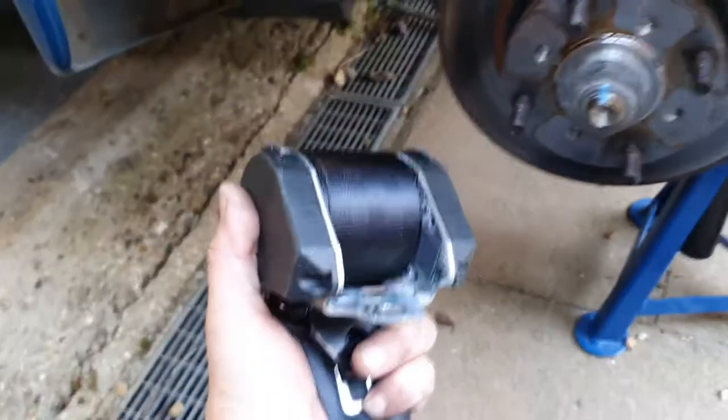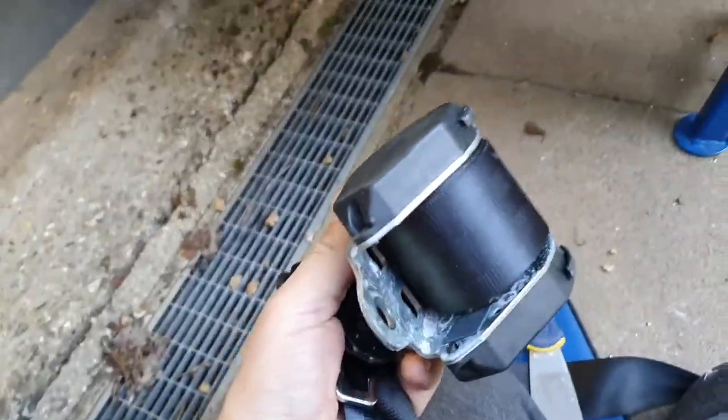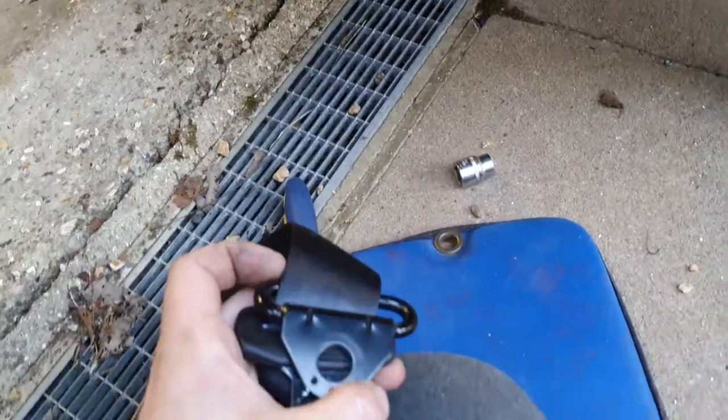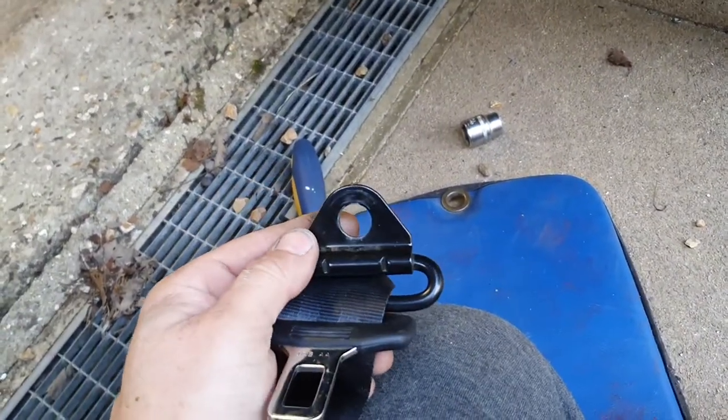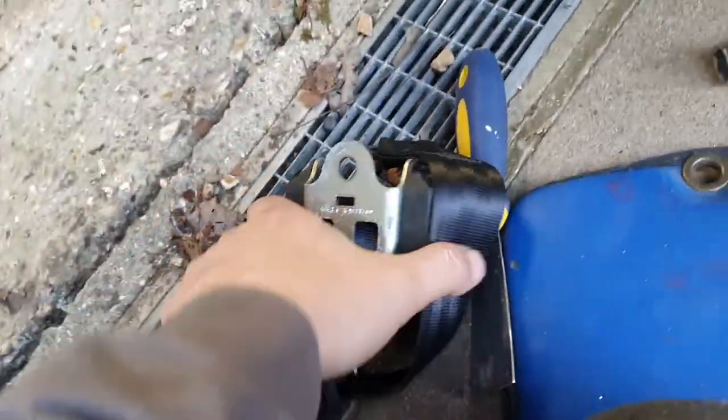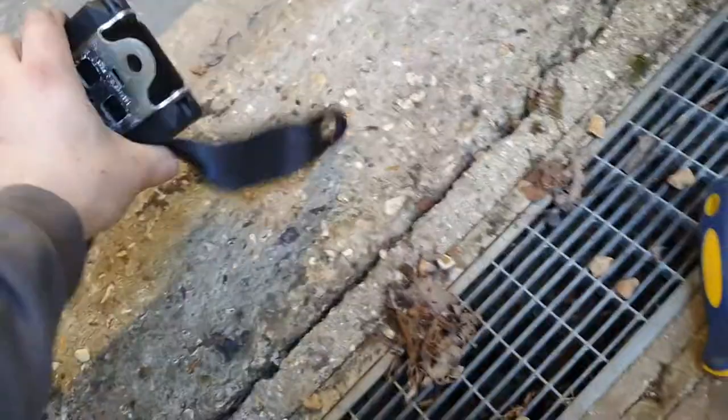You won't get it in without pulling out, so you need to literally unwind the retractable belt because there's not enough room otherwise. So I just unwound it and wrapped it around the headrest. It looks like you won't be able to do this, but you can actually thread these through the hole. They are very tight, but you can get them through. So I haven't had to cut the belt in any way — it's perfect, I can use it again if I want.